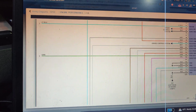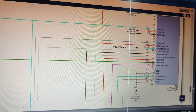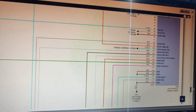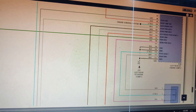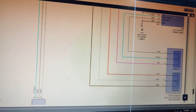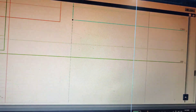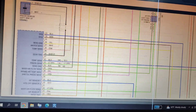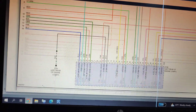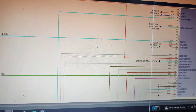That's interesting. We got three grounds - ECM goes to the left rear engine compartment, pins 108, 109, and 112. Looks like those are our only grounds according to this diagram, because there's no grounds on this other one. So we'll check our grounds - maybe we got a wiring issue too.